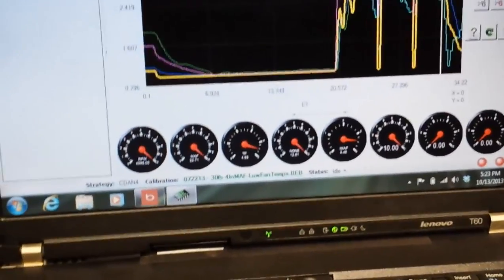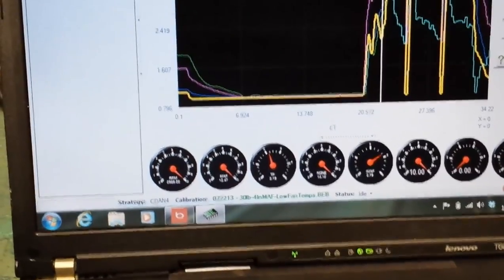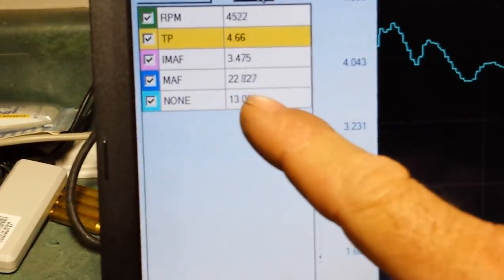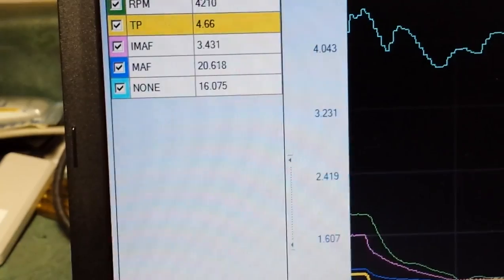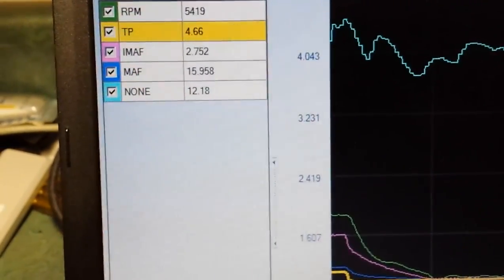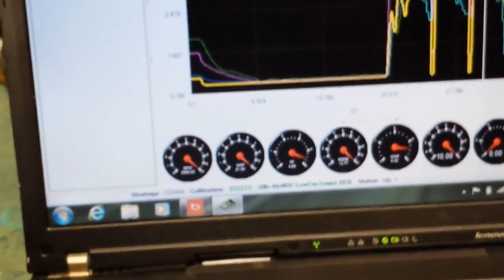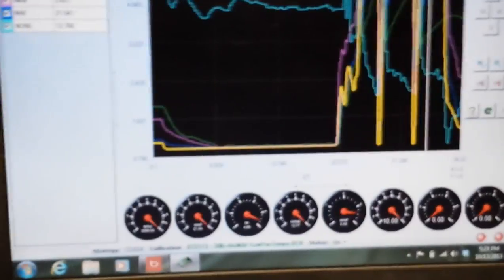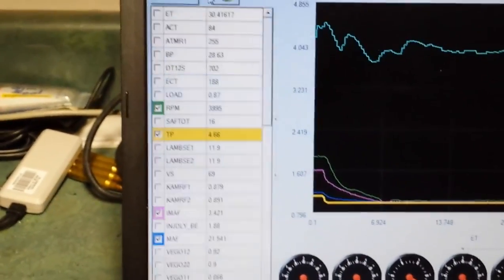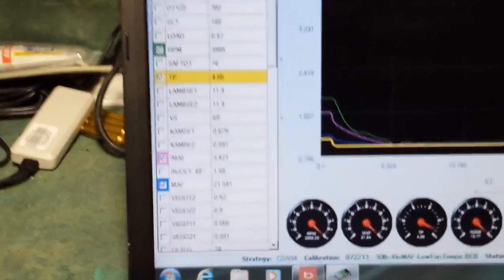It's cool that I'm sitting here in my garage, and I just made one run, and I'm able to look at all the readings in real time like that, and see exactly how it went. So I don't even have to look at it while I'm driving. I look at my wideband in the dash pod a little bit, but that's it. So I can log it and then review this later. I can add other things, like fuel trims, and see maybe what points I need to adjust and go back and adjust the curve later.